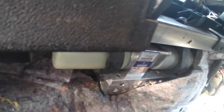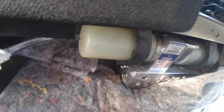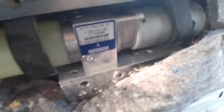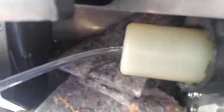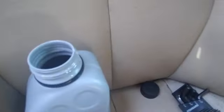We're going to inject it through the hole. We keep injecting until we reach the plus sign — as you can see, this one was completely empty and you can tell how the oil starts to show in there. It is very important that you have the vehicle level. Right now I am not in a fully level position, but I'm going to put in quite a few shots and then try to level it out and add some more.